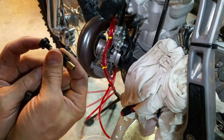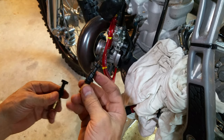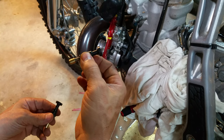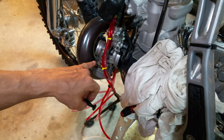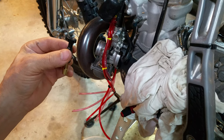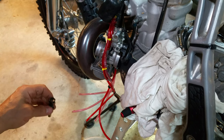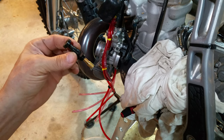There's your answer — if your choke button will not stay up, just replace the whole assembly. You can buy this on eBay; just search for whatever bike you have. If you know the carburetor model — this is a Keihin PWK — these fit a wide range of Keihin two-stroke carburetors. Search for Keihin PWK, PJ, or PE, whatever your carburetor model is, and you can most likely find a brand new replacement choke button.